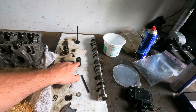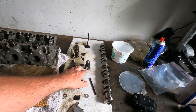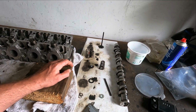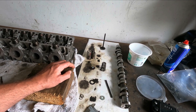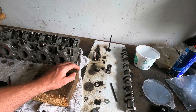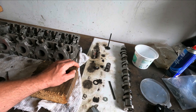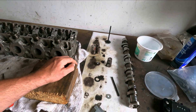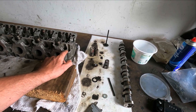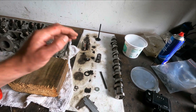What I'm going to do is put these springs in. Originally CATCAMS gives a value at 38.8 millimeters installed height with a pressure of 41 kilos. At maximum lift, they measure at 9.5 millimeters and give 75 kilos. I'm going to measure the M113K springs and see what the installed pressure and maximum lift pressure are, then compare them to the 9.5 millimeter reference.